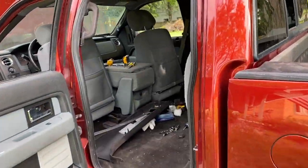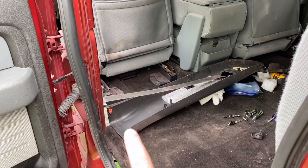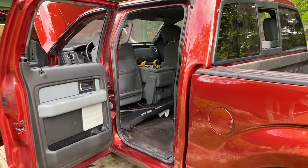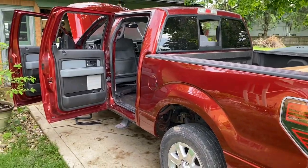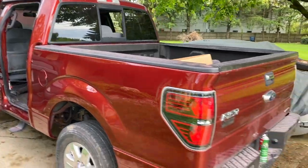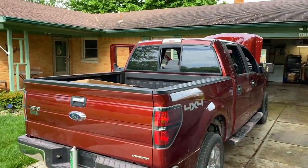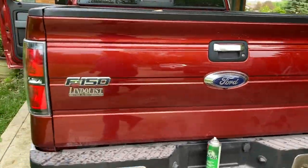Just about done and I was starting to put this B-pillar back together and I realized — since I have the seatbelt unplugged, that's part of the airbag system. So I decided to go ahead and pull the power just to be on the safe side. No need to trip some airbags for no good reason. Don't know if it would actually happen, but I don't want to risk it. So while I'm waiting for that to rest for a little while, I went ahead and put in that new taillight I already had, then swapped in our other new taillights so they now match. And with this color, man — these smoked lenses — boy, that looks awesome. Loving the look of this.